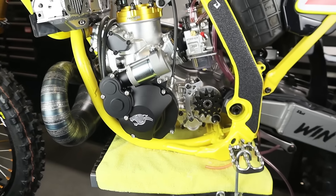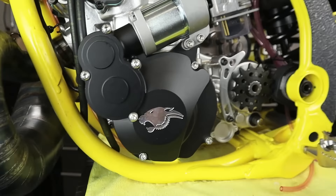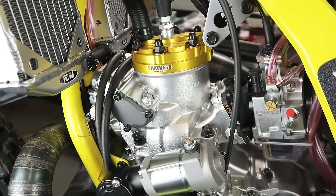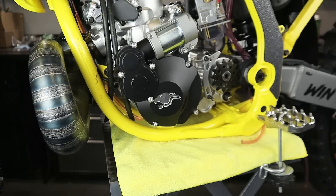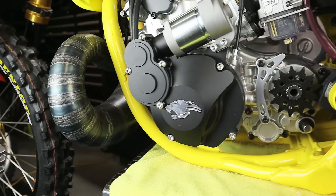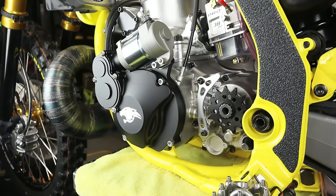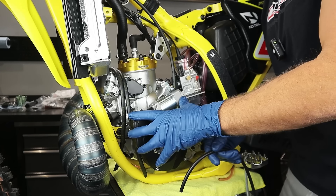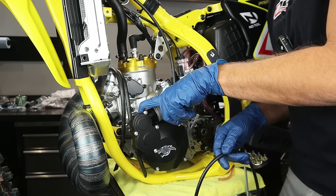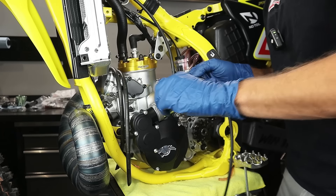Get all the bolts in. I'm going to recommend blue thread locker on these as well — we're not doing it because we'll be doing some bolt customization. Also, that would have been your chance to fill this with the recommended ATF or trans oil of your choice while those gears are out. Definitely want to give the 1211 and that weep hole a little more time before we put in oil. Man, that looks so trick on your bike — all the silver and the logo looks really good with the vapor blasting on your cylinder and cases.